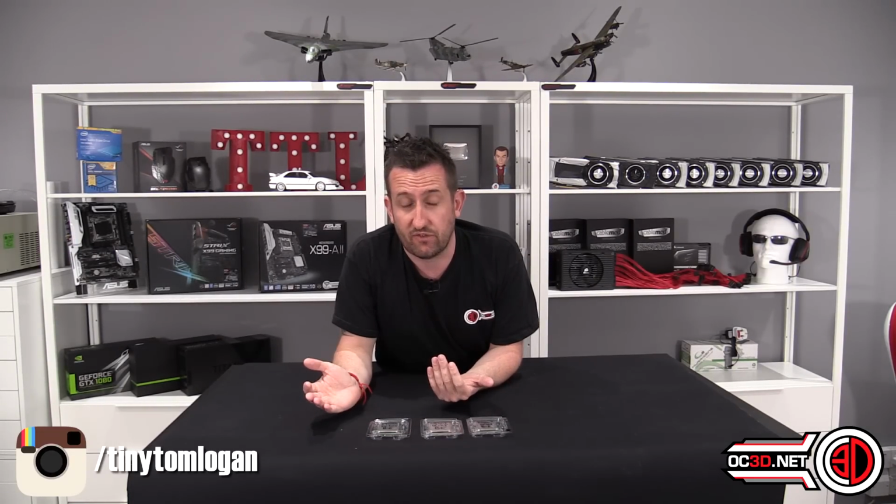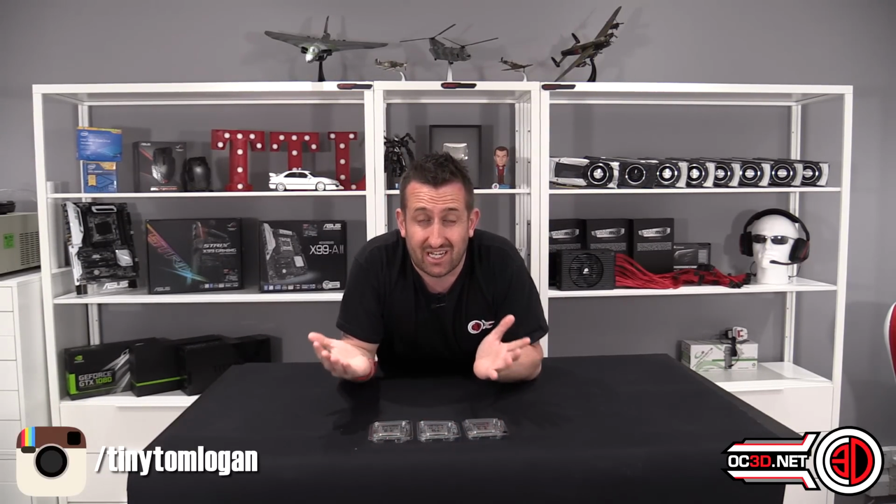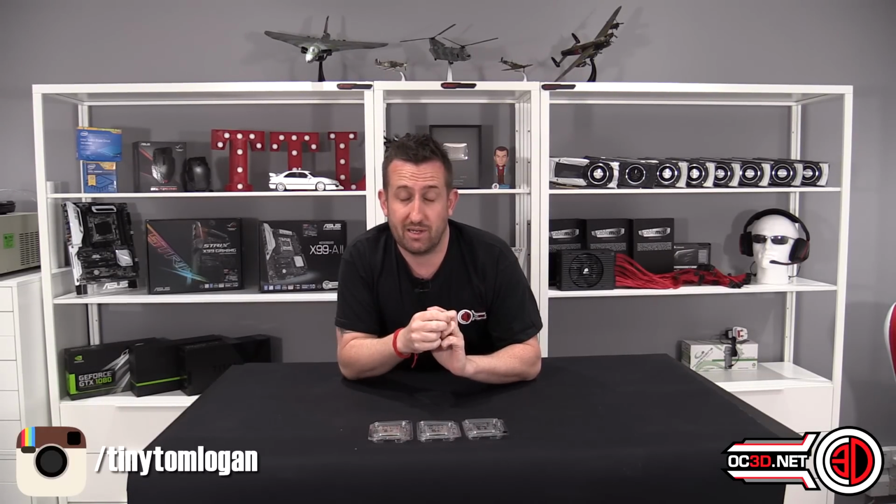So when the turbo kicks in, they can all run up to 4 gigahertz rather than just a single thread. So essentially, in the grand scheme of things, if you get yourself a decent motherboard rather than some cheap one, and when I say decent motherboard, I'm on about the main vendors, and when I say cheap motherboard, I'm on about something that you might find at a PC fair. But to be fair, if you're spending this sort of money, you're not going to be spending £100 on a motherboard. But anyway, with the good motherboards, they're going to give you, out of the box, without doing any work, a 4 gigahertz processor.